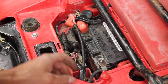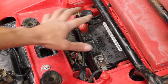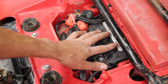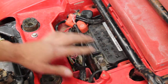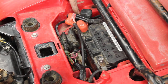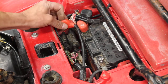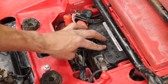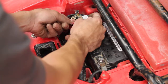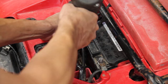I've already got the seat off of the machine. There's supposed to be a red plastic cover over the battery — this one doesn't have it, but you'd need to take that cover off. Then you'd be looking at the battery, and the solenoid is here. It's round and it's in a rubber boot. Leave the battery there. The solenoid has two 10mm nuts on top — take those off.